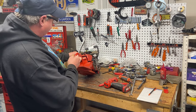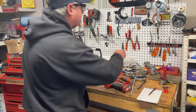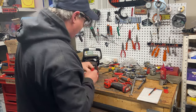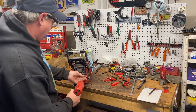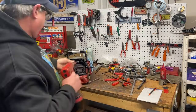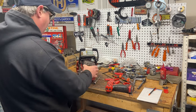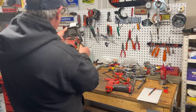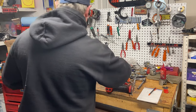The mount part for the back is put on one side — no big deal, it can be changed. It's got the OEM air filter adapter on it and looks in okay shape. Let's get the muffler off and then the cylinder off. It's a little cloudy today — there's supposed to be a solar eclipse today, which is supposed to be quite unique, but I don't think we're going to see it here. Two top bolts and two bottom to remove the muffler bracket. Looking through the window — it doesn't look too bad, just a couple of little lines, not seized or scored.